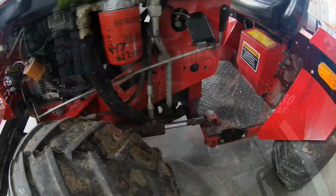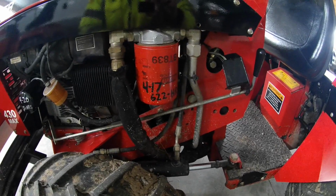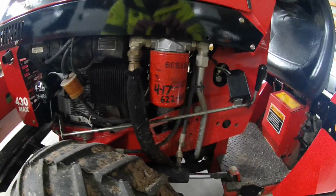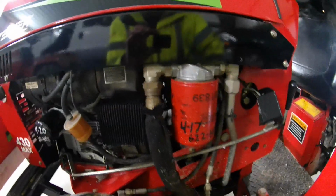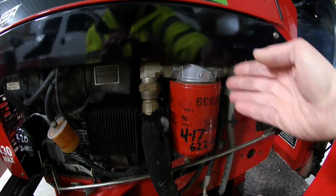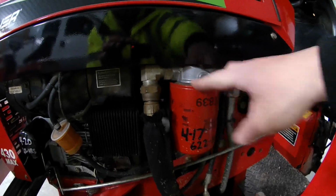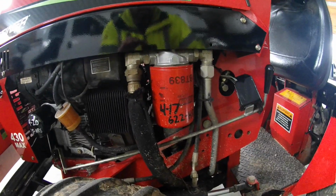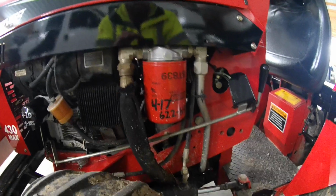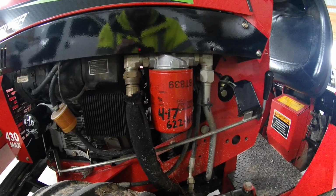Okay, now you've got both transaxle pans underneath there. They're draining, doing their thing. You come over to the other side of the tractor, and you take the hydraulic filter and you remove this. Make sure that the gasket's still on the filter, that it doesn't stick up there. I clean everything up around the neck of that unit really well, and then I take a new filter and fill it. It will almost hold just over 3/4 of a quart of oil. So I fill my new filter with new oil. You don't have to get it completely full, but you want as much in there as you can.